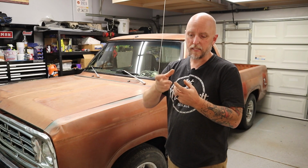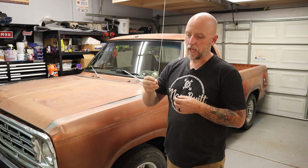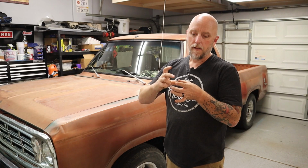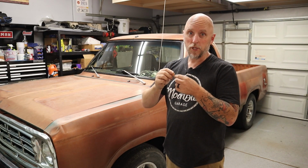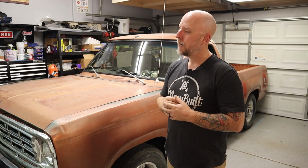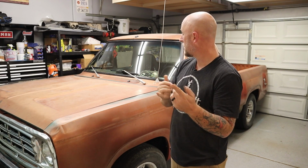But I think it's the pickup, the magnetic pickup on the back of the speedometer. I was kind of turning it by hand and that needle would work and then not work. And it just seems like there's some play in maybe one of the bushings in there. I did lube it all up, but it seems like there might be a little bit of play. I may have to look into getting a hold of a new speedometer.